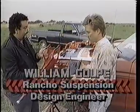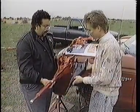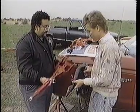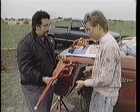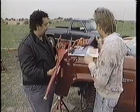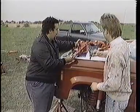It sure is. As you can see here, it's approximately 11 inches longer than the stock arm. We gained this knowledge pretty much from our full-size Ford kit. What this gives you is increased wheel travel, improved front-end geometry, better ride on and off the road. And all your hardware looks like it's been beefed up here. The bracketry looks pretty heavy-duty.